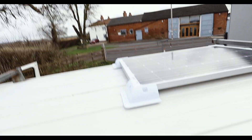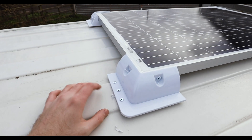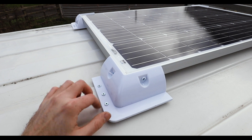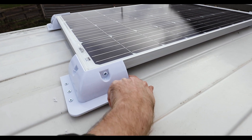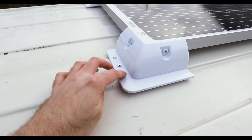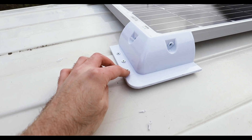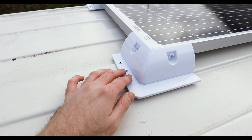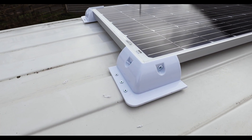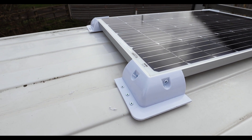While I'm up here screwing it down, let me quickly show you how we've mounted it. The annoying thing is because of the ribs on the roof, the feet don't fully sit flat. I've put three screws in the front and I'm going to Sikaflex around here, Sikaflex on the inside as well, and also Sikaflex from inside the van on the screws to make sure no water can get through. It's got around ten screws total holding it down plus Sikaflex, so it should be solid.